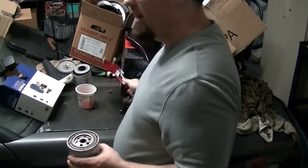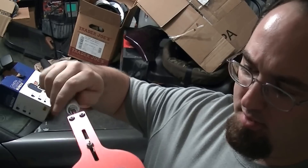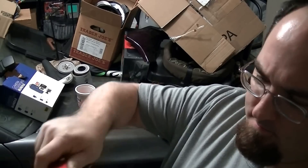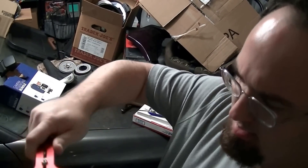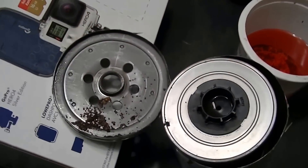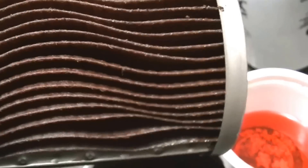How bad was the end of that? Now this is after all those flushing videos I did. This is that coolant filter right after that - the very first coolant filter I ever installed on there. I'm a little flabbergasted by this. All those flushing videos you guys saw I did - I flushed the living mess out of this thing. I am incredibly surprised to see how much nastiness was in here. Wow, this thing was filthy. Just chunks of rust and dirt. These pleats are very, very dirty.